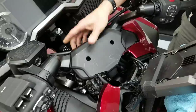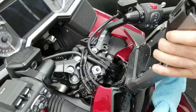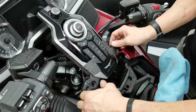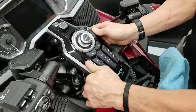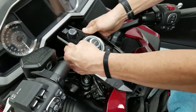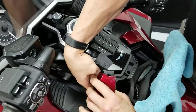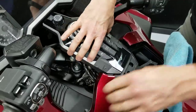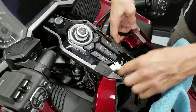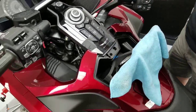I'm leaving this semi-disassembled to show you. This goes back in reverse of the order we talked about in the first video. This slips under, the console slips under, snap the nose down, slide it backwards. Then there are two 5 millimeter Allen bolts that go in this hole and a pop rivet pin that goes in there. These snap down, close the cover, and you're basically done.